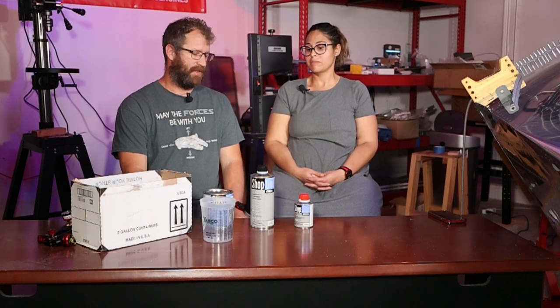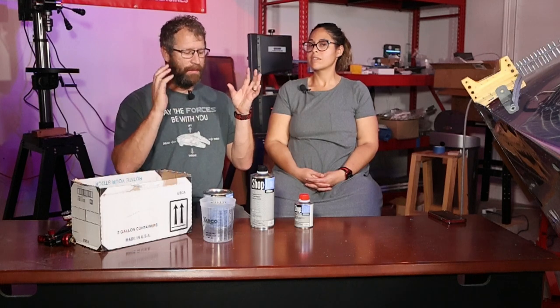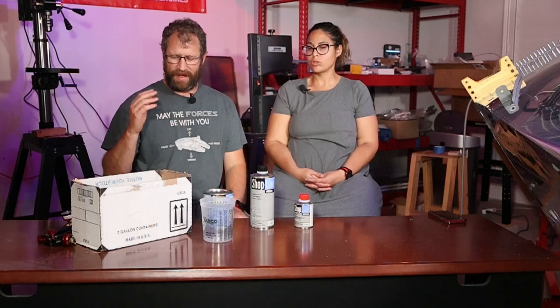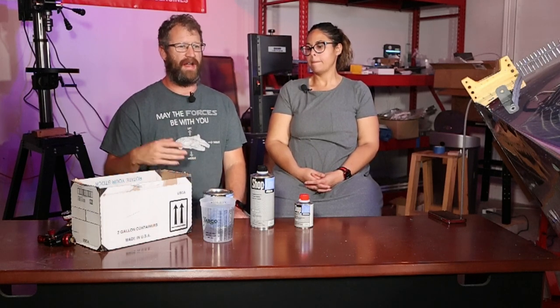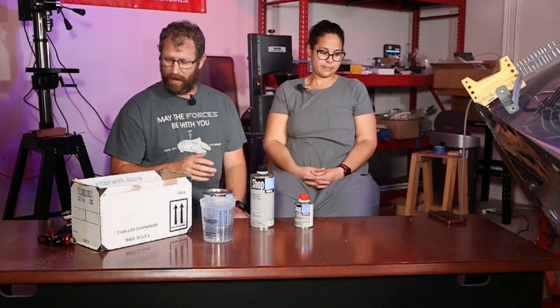And then if it's really hot outside, you want slow. Really? Yep. So that's just one of the things. And he actually asked, when are you planning on painting? And because he almost went and he made sure we got the right thing. Not the super hot one? Yeah, I don't think it's super sensitive. And also, if you're painting white, long, big areas, and you want it to stay wet longer, you may want to go with something slower than that. But for what we're doing, I think we're in good shape here.